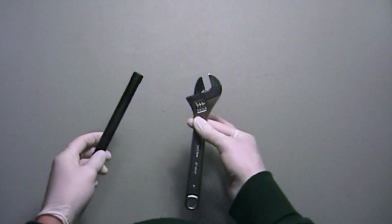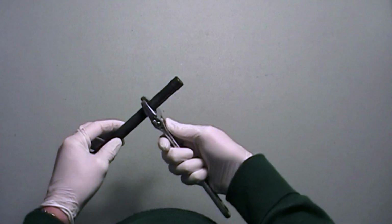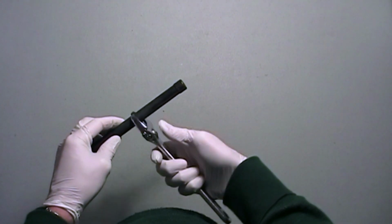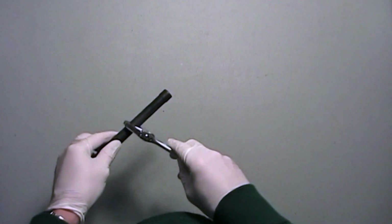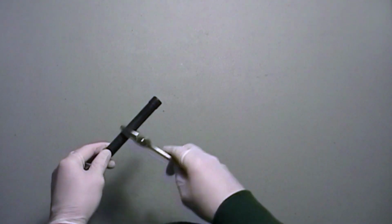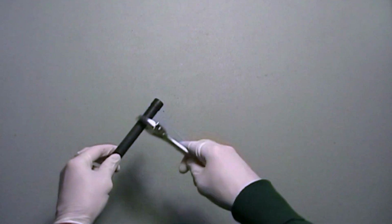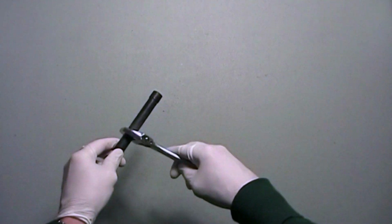The best way to get it off is to use an adjustable wrench to tap it off. Set the wrench so it just slides along the tube, then strikes the edge of the cap. Start tapping, rotating the tube as you do so as to apply even pressure. Go easy. The key is to be patient. Copper is a very soft metal and it's easy to tear or rupture. If you do so, you'll have to buy a new one, so take your time.